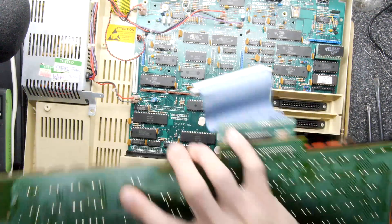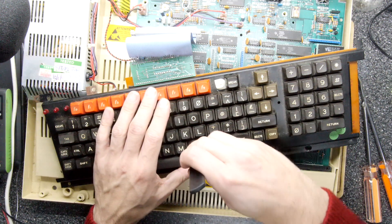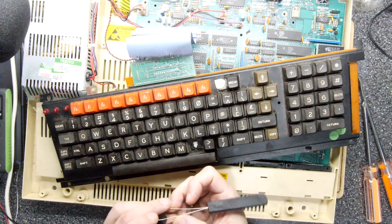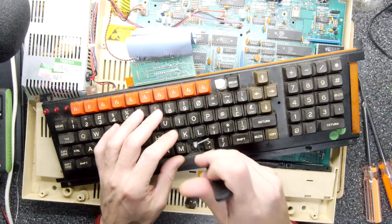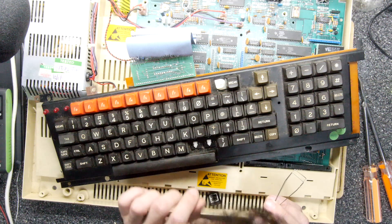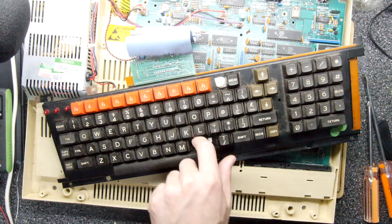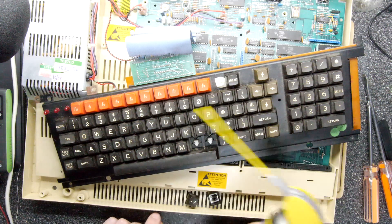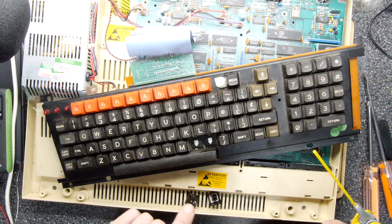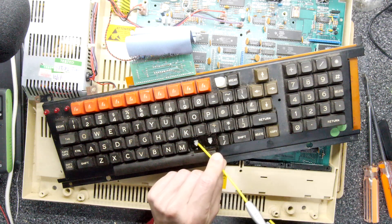So it may well be the keys themselves. What we could do is go a little bit further. With our keyboard keycap extractor, which you can get for pennies - and I advise you get some - you can pop these off without too much difficulty. And here lies the issue. You've got two options at this point: if you've got some contact cleaner, you can try applying that and hopefully that'll do the job. But if that doesn't work, we're going to have to desolder it from the back.